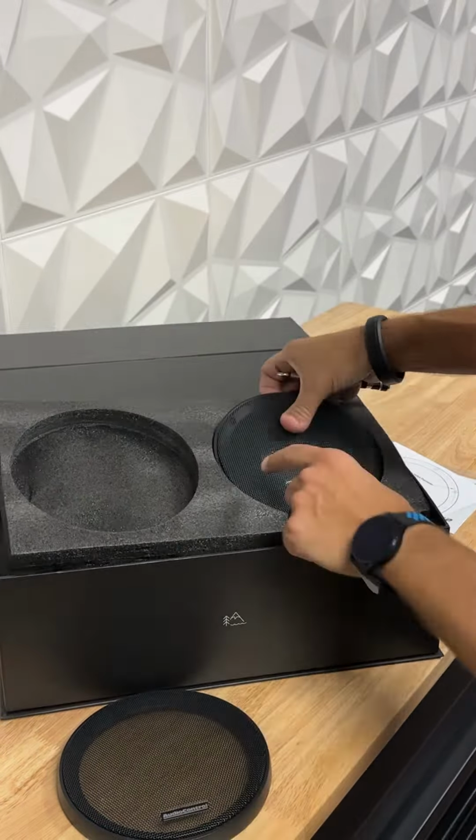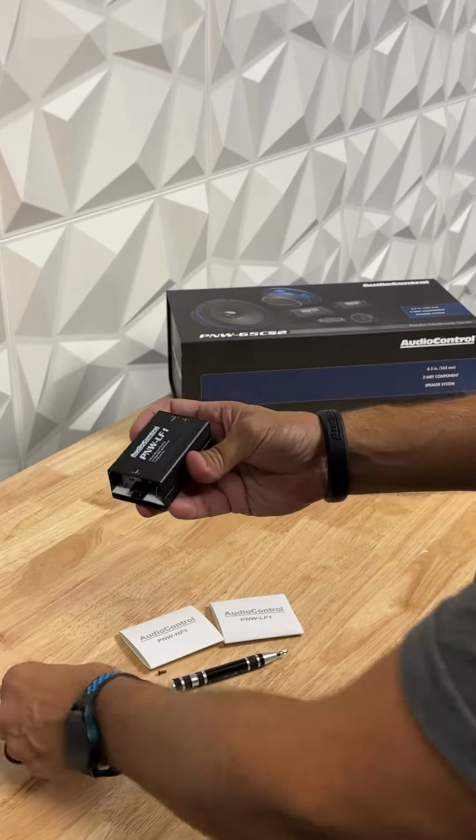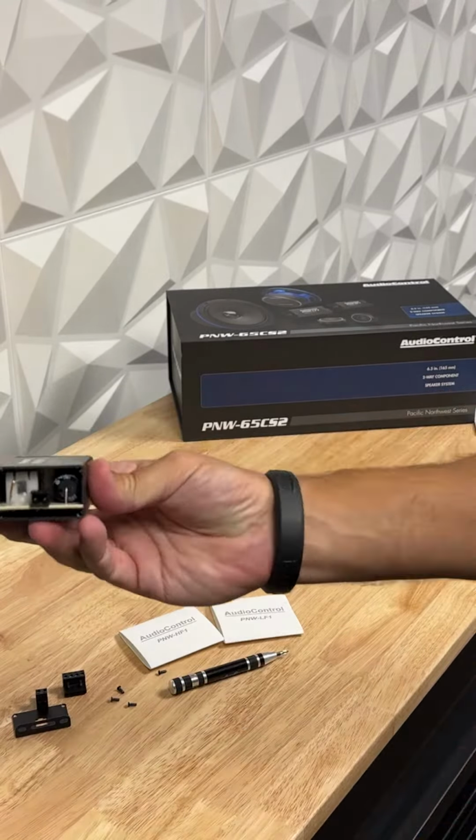And all we have to do is take a Phillips screwdriver, and on the end of each housing, there's 4 screws. Simply remove those screws. Now, with the 4 screws removed, we can unplug our connector. And we can slide the end plate off. We can actually unplug both connectors. And then we can just take the circuit board from the inside, and we can just slide it right out. If you push on the connector from the other side, it just slides out just enough. You just slide that right out of the metal.